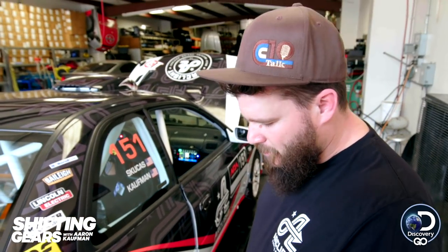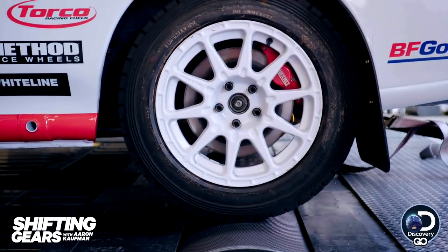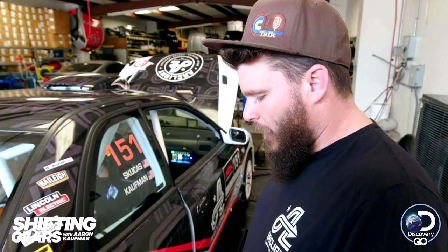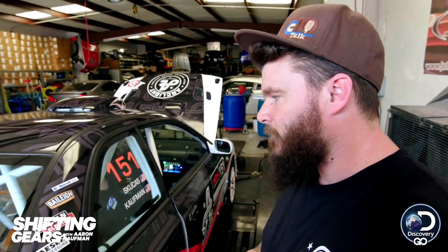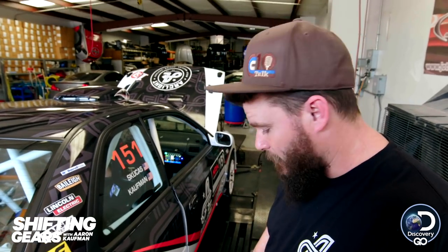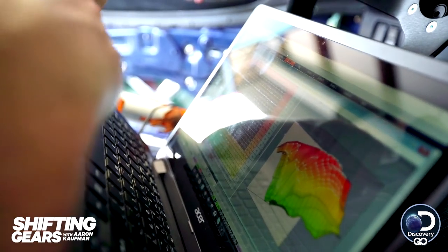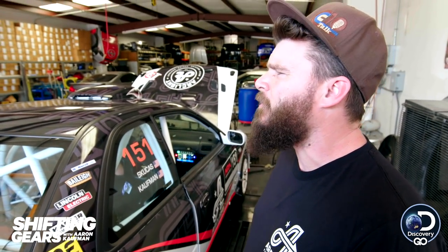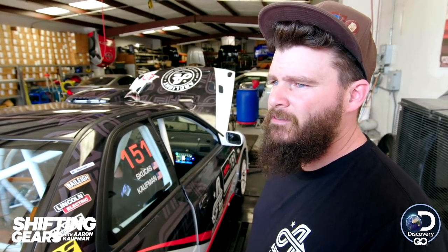The tires are very heavy sidewall — a lot of rotating mass — and I think it's just the nature of these tires to shake. They're specific rally tires for gravel, and the speeds it was vibrating at were well over 100 miles an hour. Aaron will probably hit that speed, but on dirt it's way different than on steel rollers. After a couple of second-gear pulls to dial in the rest of the fuel, we made 130 horsepower and 146 foot-pounds — or 131 horsepower and 150 foot-pounds.